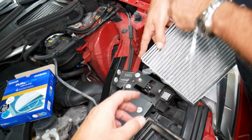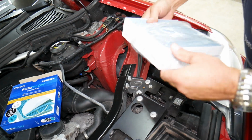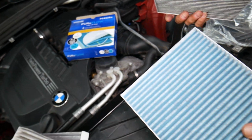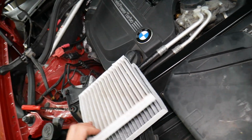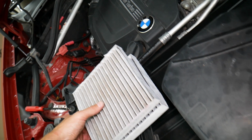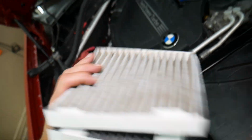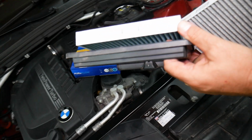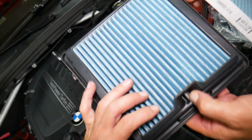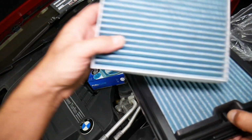Okay, be careful not to punch a hole in them when we pull them, because they will not work effectively if we have a hole. And we need to, okay, airflow, you can see both of the arrows need to point towards each other, because it sucks from the top and the bottom as well, guys. So airflow in our case, one needs to be on the bottom, and on top, pointing towards the bottom, and the other one will be the other way.